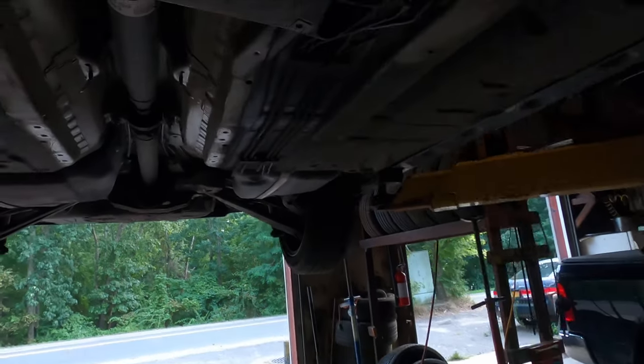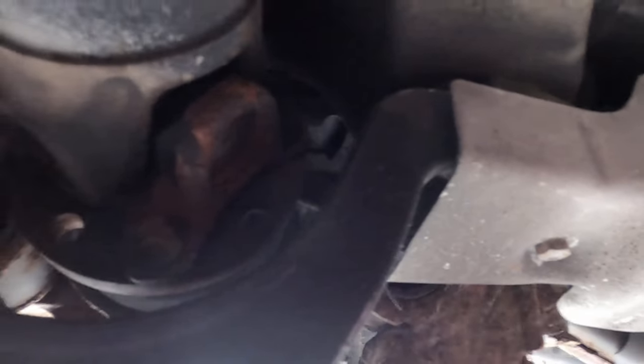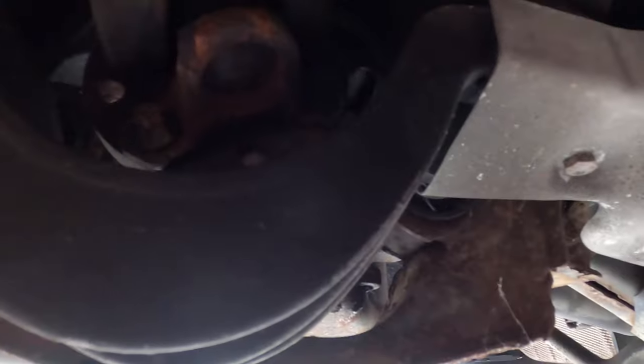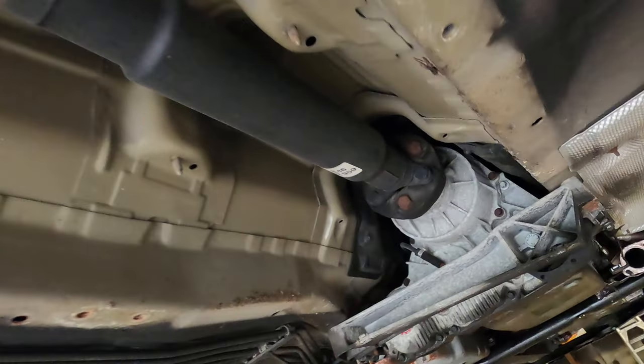So, revealed is the drive shaft. We're gonna have to remove these two bolts for the center coupling. That should just pull out, and then we're gonna need to get the inverted Torx bolts and do four of them there. I would leave it in neutral so you could spin it freely as I did, because I planned that and it didn't just happen by accident. You tried it. And yeah, we'll go from there. You know what sizes those are in just a minute. Once I figure out what I'm gonna be doing, I'm gonna have to find actual tools like that. So let me get those first.